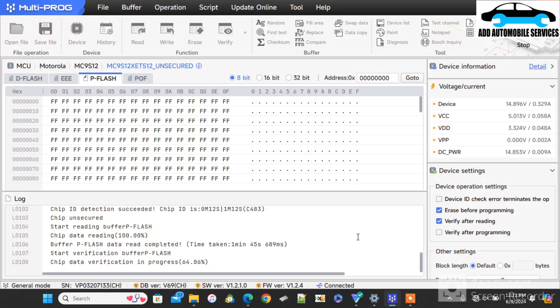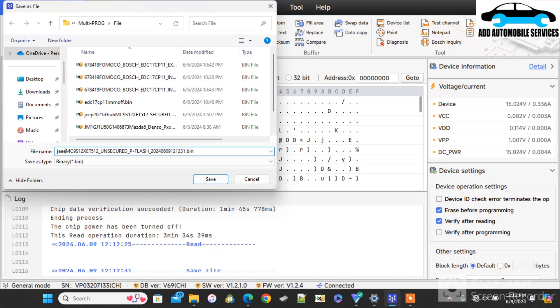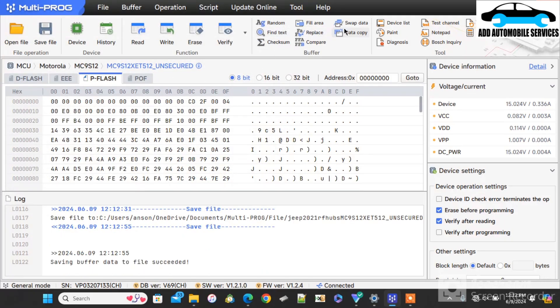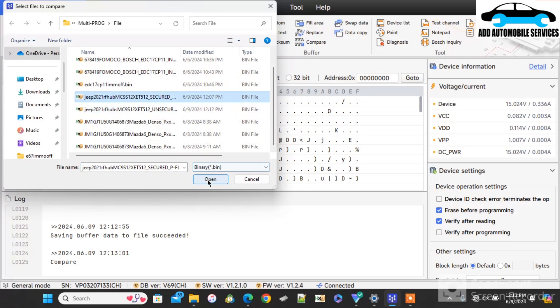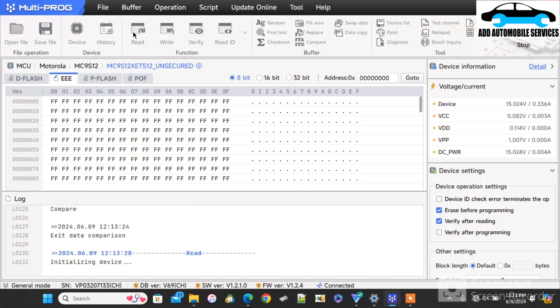I'll do one or two edits. For the car, I just changed the EEPROM, wrote the old data on the new one and it was good to go. The password is not a static password — we have something called a rolling code, so the password changes anytime you go to the car to program it. I'll save this one now that I've used the unsecured chip to read it, then compare it with the data I read using the secure protocol to see if there is any difference. There is no difference, so it's the same thing.